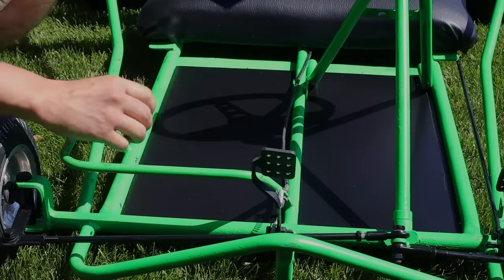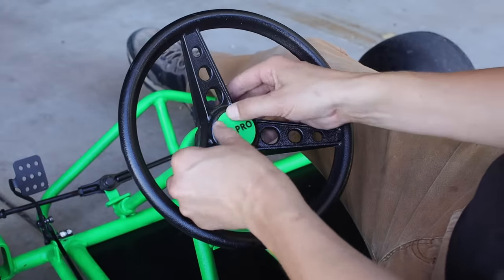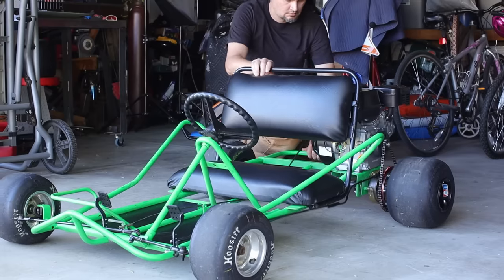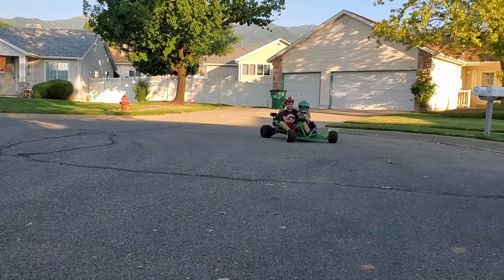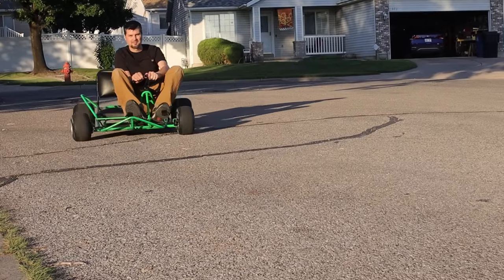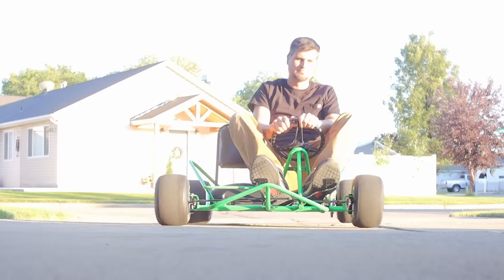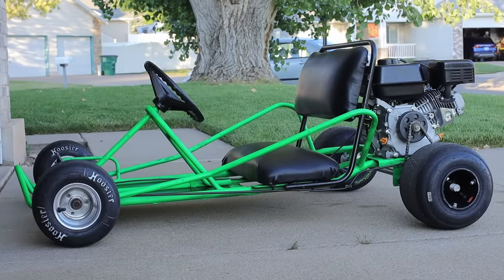Here's the reveal of the ACM — aluminum composite material — for the floor pan. I think it turned out amazing, plus a 3D printed DIY Pro logo. Let's get it cranked up and start cruising. People will ask if I'm selling this one — no, my boys will definitely not let me sell this one; it's staying in the family. Speed-wise, with about a 60-tooth sprocket on the rear it goes about 20 to 25 mph — you can change the sprocket to go faster or slower. As for the total price, I'll put it up on the screen.